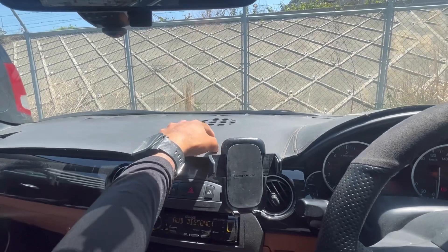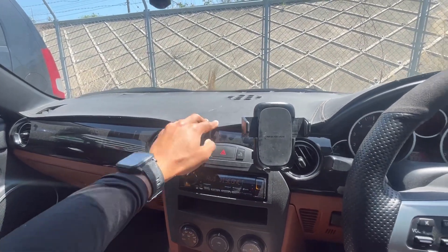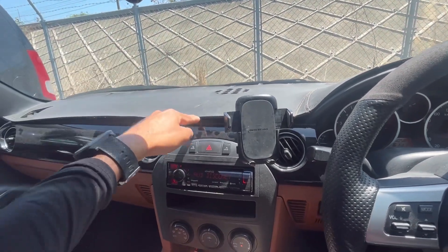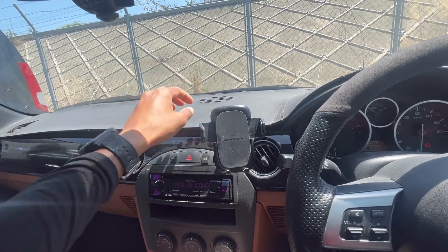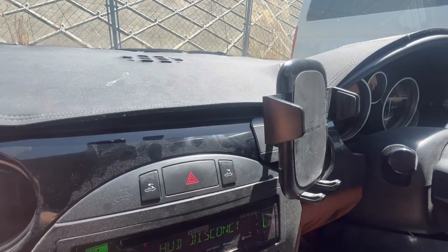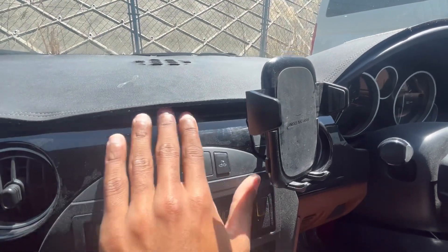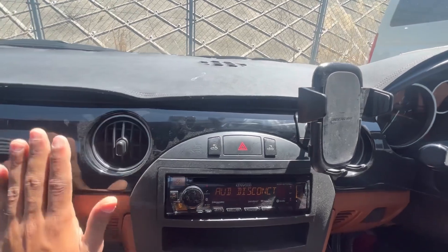I don't like fixing anything to the top of the dash because the vinyl has a texture to it. When the sun beats down on the double-sided adhesive, it goes through softening and hardening cycles, and the adhesive really sinks into those grooves. When you want to remove it, it's going to leave behind really tough-to-remove marks. With one of these, just use a little bit of heat from a hairdryer and a plastic pry tool, and it will come off really clean. Maybe use a bit of isopropyl alcohol for a final wipe down — no markings left behind, especially on this nice smooth glossy surface.